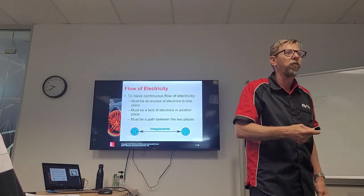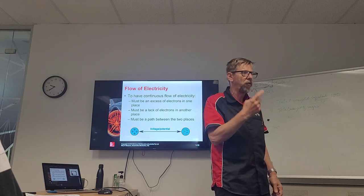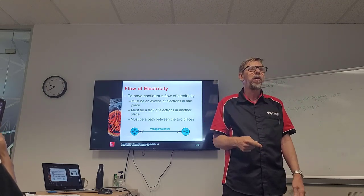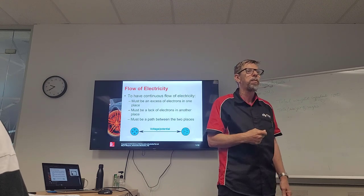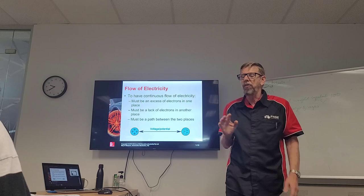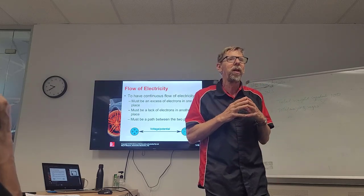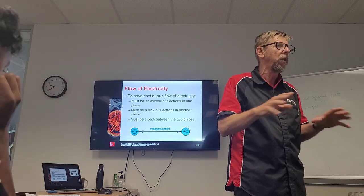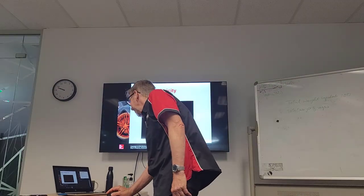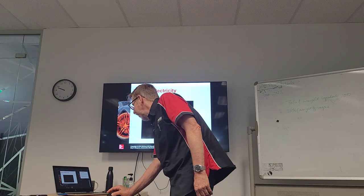If it's a ground control circuit, for example, if the circuit is open, that can tell us that we've got good wiring because there's voltage at the opposite side going back to the ground side. And I might be losing you on that, but when we do some of the hands-on stuff later on, we'll get to feel all that, okay? All right.